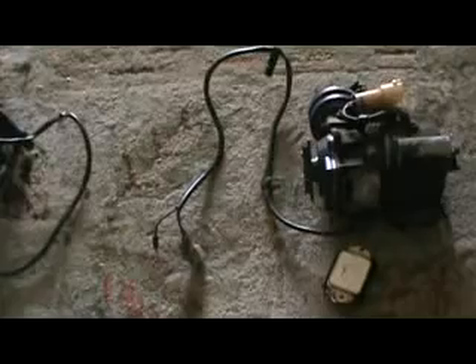So what do you think the next thing you're supposed to check is? That's right — what you're looking at right there. I saw that I was getting spark from my main coil, which is the next thing you check. I had a pretty good spark coming out of there. So then we've got to go to the spark plug wires. I pulled the first wire and set it by the ground. I heard no clicking. Guess what? Distributor out.